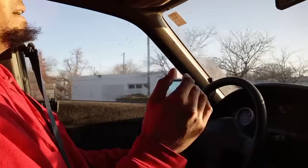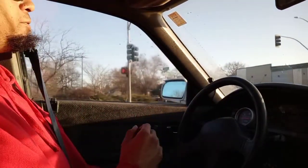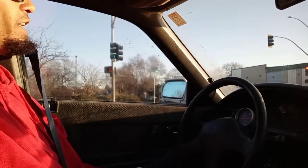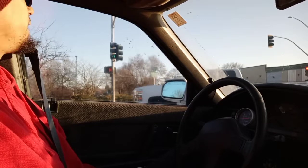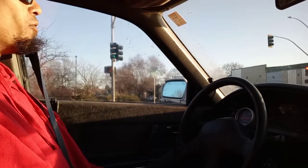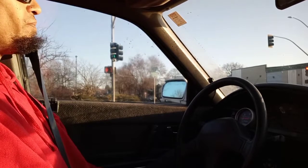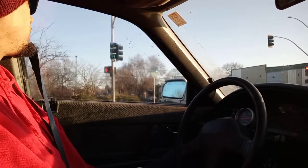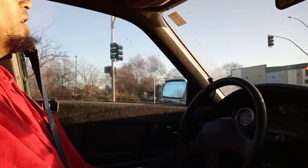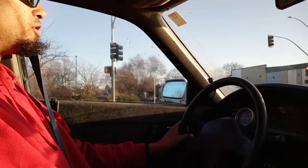Boost lag is how long it takes from when the turbo starts spooling to when it's at full RPM and producing the boost level you're trying to make. So you're limited by load at that point. What brake boosting does is allow you to add load to the engine without increasing RPM. In other words, your turbo is spooled up quicker than it would be under normal driving.